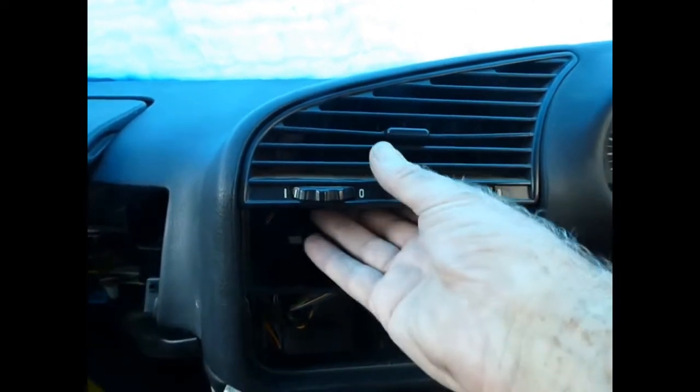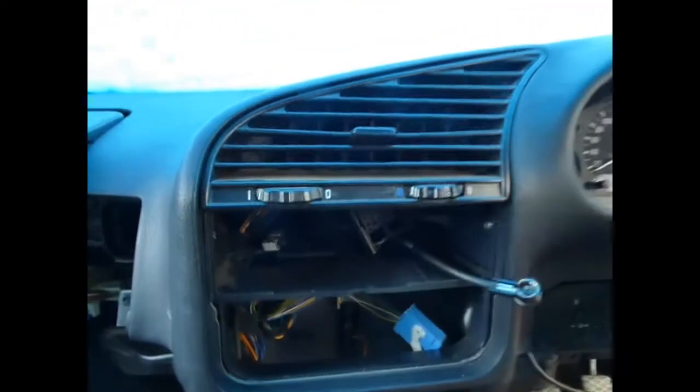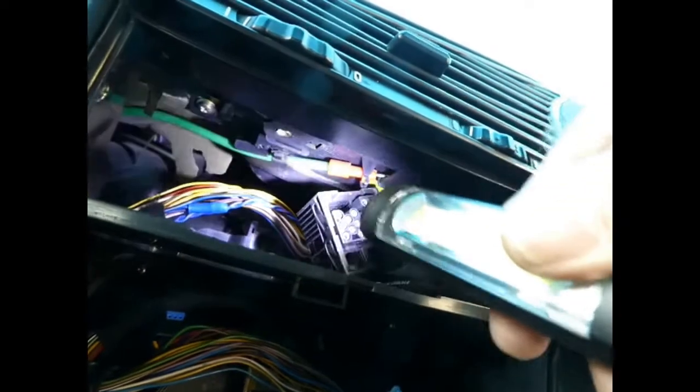Now with those two screws removed, this is supposed to come out. There's a tab there that locks in behind and holds it, so it has to swing sideways. But the back there — you can just see where it plugs in, effectively into the air duct. And that air duct is held by a screw at the far left. As this comes out, the back of it has to move sideways, and the air duct won't let it. So the answer is to slacken that screw, and then it all becomes quite easy. Without that, taking this out and replacing it — getting the end into the air duct — is extremely difficult.